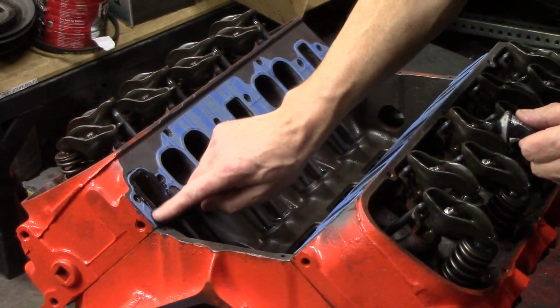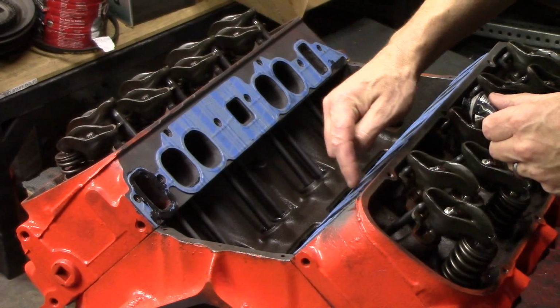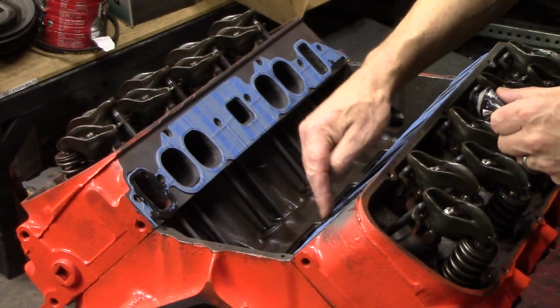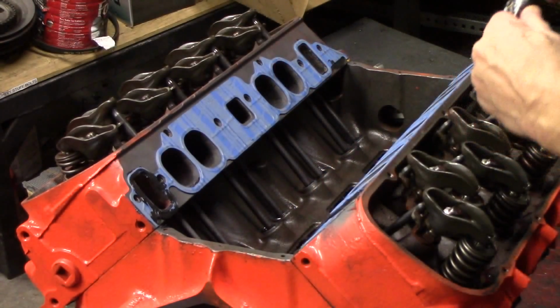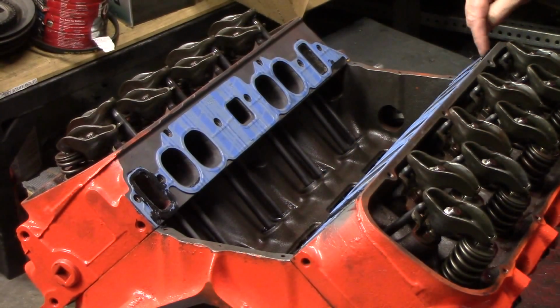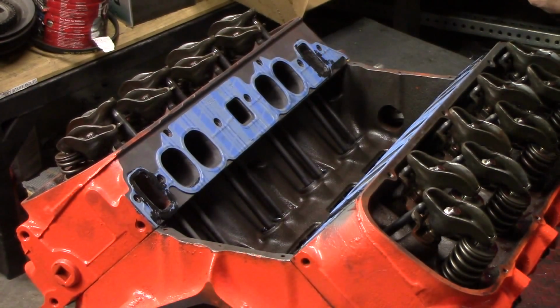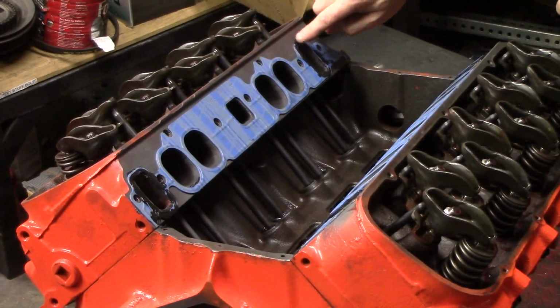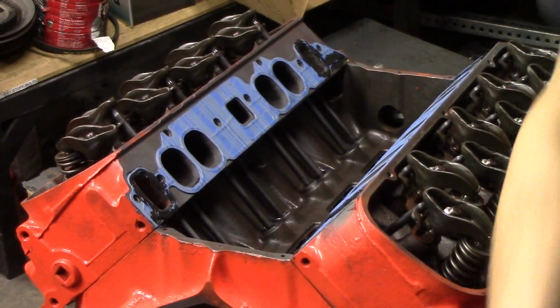We have our intake manifold gaskets on. We've got all our valves in, got our valves adjusted. Place your intake manifold gaskets on the cylinder heads, and we want to put a bead of silicone on all 4 corners where the water jacket or the coolant jackets are to assure there's no leakage. In addition to that, there are some gaskets that go on the ends of the intake manifold, but if the cylinder heads have been resurfaced or the block has been resurfaced, which this one has in the past, those gaskets never fit right, and you really don't want to use those because they will leak.